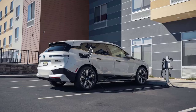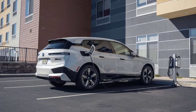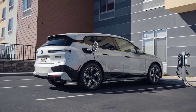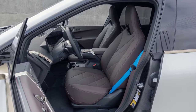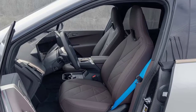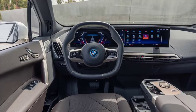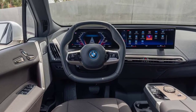Move past the 0-to-60 mph and quarter-mile times, and the iX's data starts to look more average. Our test model, even on 21-inch summer tires, hung on for a so-so 0.86g on the skid pad and needed a good-but-not-great 120 feet to stop from 60 mph. There's no getting around the culprit: the iX's substantial mass. Finding a direct comparison for the iX is tough — it's larger than Audi's slower e-tron EV SUV, smaller and less powerful than a Tesla Model X Plaid. The gas-fed BMW X5 M is closest in size and general performance. Even so, the iX delivers more driver satisfaction than its objective test numbers suggest, with an agility that belies its weight.